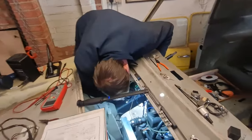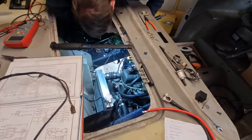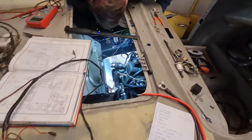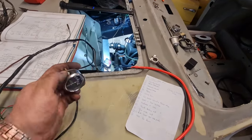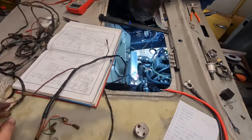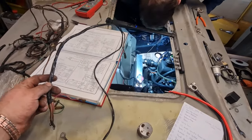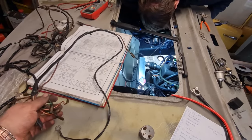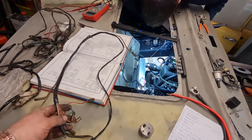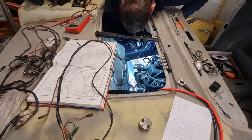Dan's been beavering away under here - we've got all the fuse box plugged in and the wiring worked out. We've also worked out that this loom actually came out of a 21E car - 21 Extra - so there's a part of the loom which is cut, and we've got this extra sub-loom which takes its place. It also means I can run an ammeter, so I'm going to have a little ammeter in the van which is nice. This loom also gives a provision for front fog lights, which means if I ever want to retrofit some hidden front fog lights I can, all within the original loom.